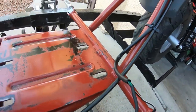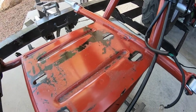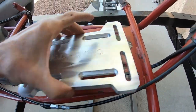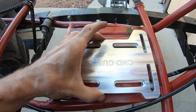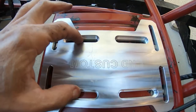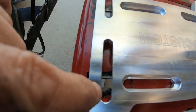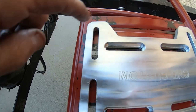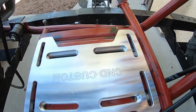The engine fits in the stock location just fine, but it's over a little bit. I could have just drilled holes in the stock location, but I like the idea of being able to adjust it wherever I want. The slots on this mount aren't long enough to just bolt it down, so I'll have to drill a few holes, which is easy. If I mount it right here, I still have all this range to slide the engine from side to side — another inch over to the left or even a little to the right. Bolting it right there will be perfect.